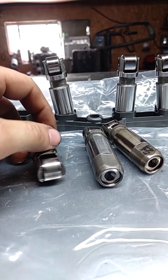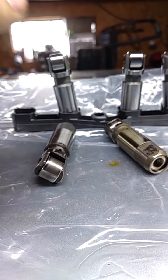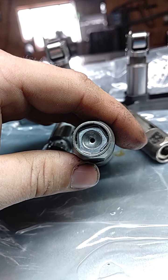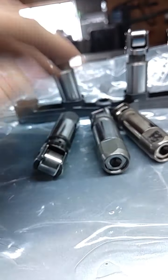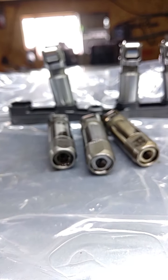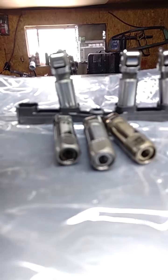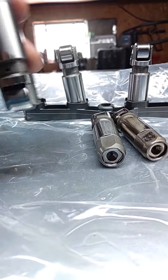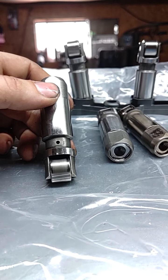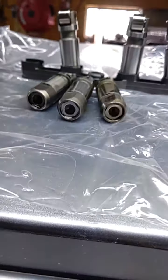Externally, the only difference I see is this plunger here. Let's see. Can't compress it in. No, so this will be a disassembly thing next, but for those who are wondering about Hellcat lifters, externally they're the same, except for obviously the eBay set, which I haven't had an issue with. I have probably put 24 of these sets in cars. Not a single one has come back with a problem.